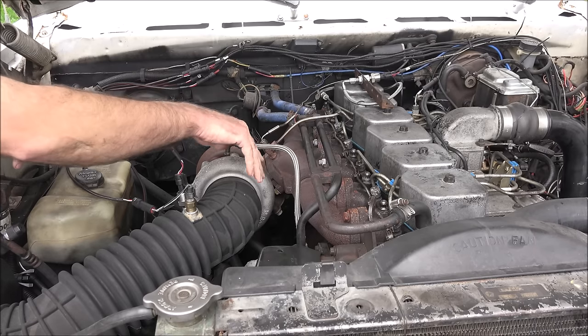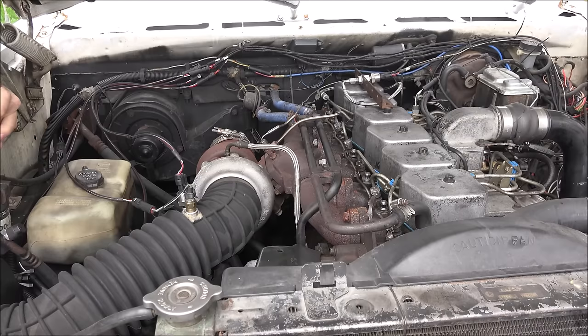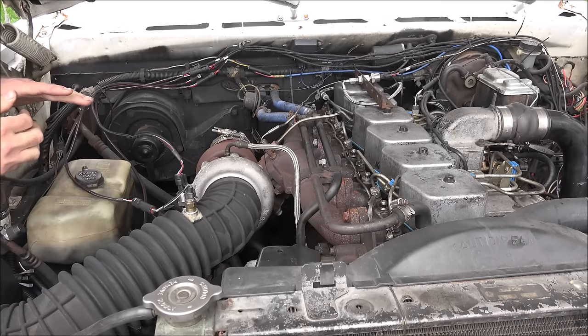You can get a Chinese knockoff three-piece manifold and do exactly the same thing. The number one deal with first-gen engines for horsepower is fuel injectors. For something in the 400 horse range, I would highly recommend the Power Driven Diesel Powerjet Stage 2 injectors — it's a super clean injector. It smokes less than the six-hole nine-thousandths intercooled tips that were in this when turned all the way up. The fuel pump is turned up all the way to make this horsepower level — it's right below runaway. Other than that, the pump is entirely stock with no aftermarket parts.